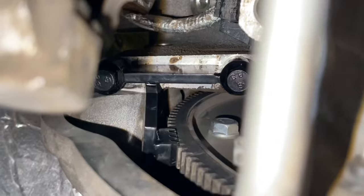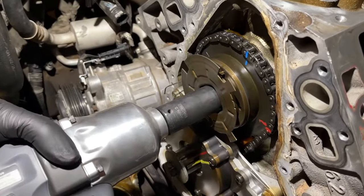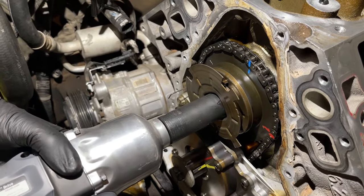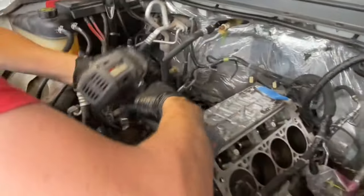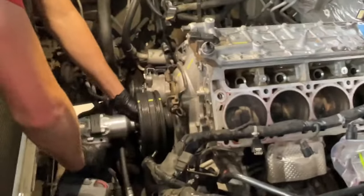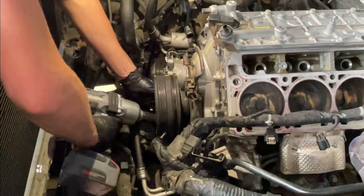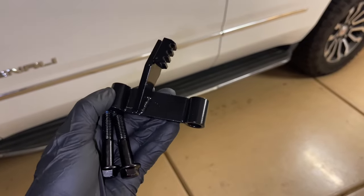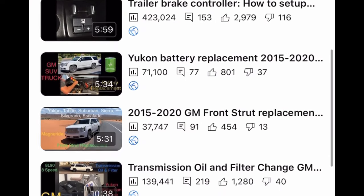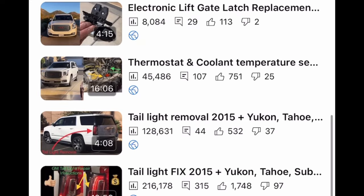When you're doing things like taking off the variable valve timing cam bolt or even the crankshaft bolt, it really helps to hold the crankshaft still by holding the flywheel or flex plate in place. It's a very helpful tool — I'll put a link in the description, it was only about 13 bucks and it's a must for breaking loose bolts. It's also great if you're doing the torque converter, a transmission, or in our case putting in new lifters. Thanks for watching, and if you're new to the channel feel free to subscribe.